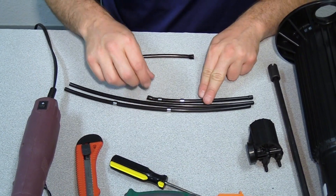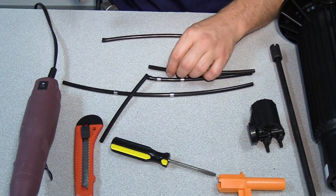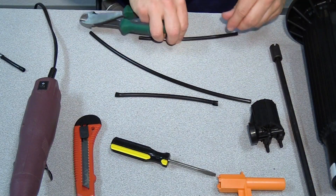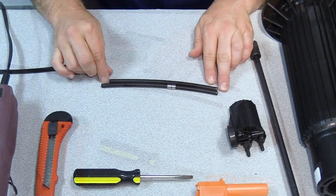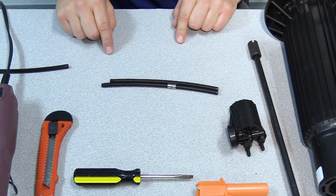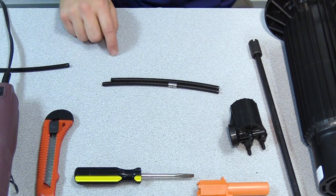Place the new tubes alongside the old tubes and measure out the appropriate length. Use the snips to trim the tubes. This is the high pressure tube, so let's move the retention clamps to this tube. Repeat for the low pressure tube. As you can see, the high pressure tube is slightly longer than the low pressure tube since the high pressure tube has to travel a longer distance down the case.